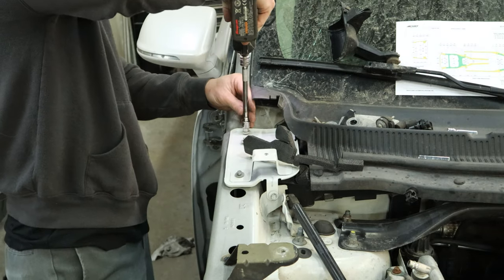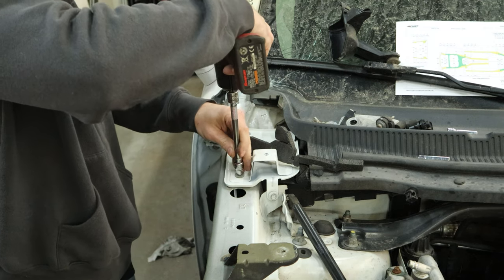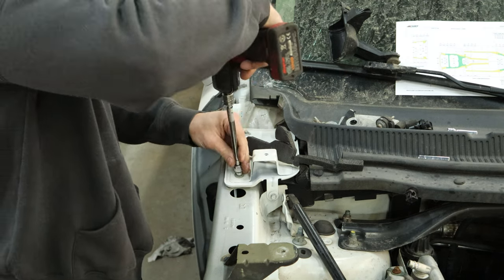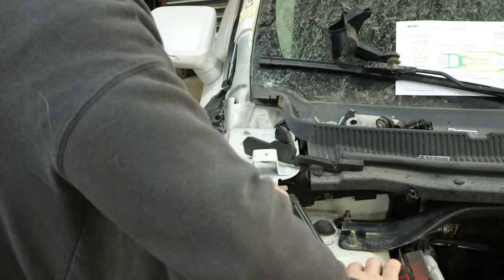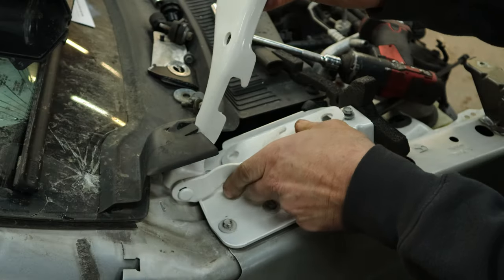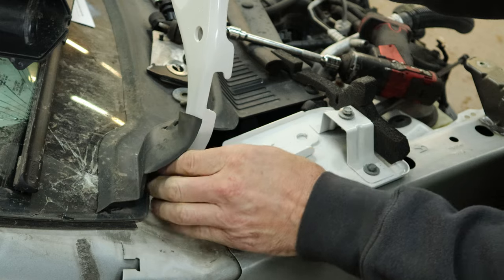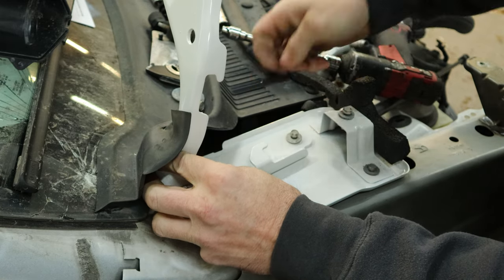As fast as I was pulling the parts off of our parts car, our painting gnome was getting them all scuffed down and sanded so he could get them painted up. So now all our paint is dry on our parts, it's time to start putting some of them in. We're going to put our hood hinge bracket back in here on the back of our cowl, and then we can put our hood hinge on it. We're going to line up all the old marks for where the bolts go and see how close that gets us. Since nothing should have moved, everything should line up pretty close.